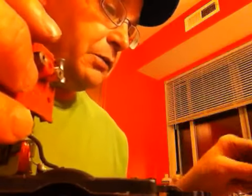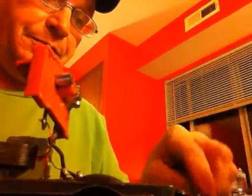And while you've got it all tore apart here, like I said, try to be careful that you don't break these solder leads. They're on there pretty good from the factory, and you can mess with it a little bit. Spray that thing down there, right there, with the CRC. Clean up around the frame as best as you can. And now we're back to our brushes that we pulled out of these two slots. And they ride in here on top of the armature.